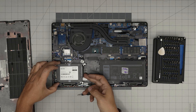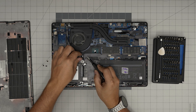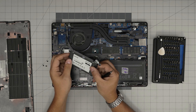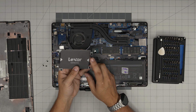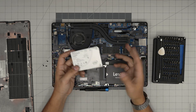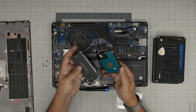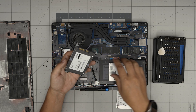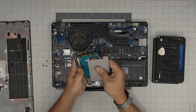Once you remove the screws, slowly pick it up. Grab the plastic handle — the tape-type handle they provide, same style as the battery handle — and pull it upward to disconnect it. You can replace it with a good brand SSD like a Samsung QVO or Samsung EVO, or go enterprise with an Intel series. You can also use a low-profile 2.5-inch mechanical drive up to two terabytes, but whatever you put in here you need this adapter.